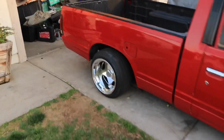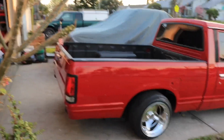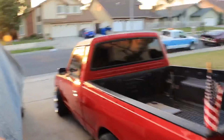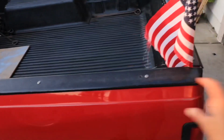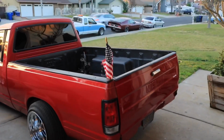Also, I would highly recommend watching some professional detailing videos, because my video is not really in depth like all those other videos. I just slapped it on there, went back and forth until it looked kind of clean, and I just wiped it off, and that was pretty much all I did. I'm sure I missed a lot of steps, but the tips I could give you guys is, one, make sure that the truck is clean, so you don't have any sand or dirt on there. And two, make sure that you're not in one area for very long. Keep moving it around, because if you stay in one spot, it's going to burn the paint. And I think that's pretty much it.